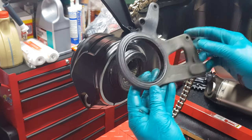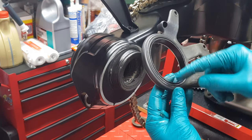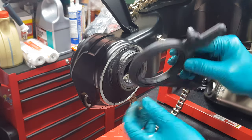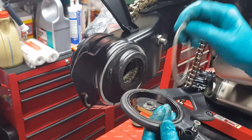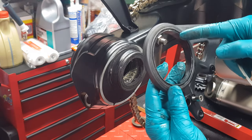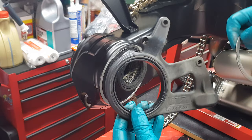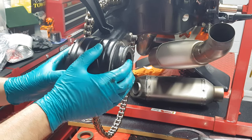Your brake caliper mount and speed sensor bracket can just slide off. Just bear in mind you've got an O-ring when you take that off — there's an O-ring here, and when you turn it over there's another washer and another O-ring. There's an O-ring on each side of this, so be careful of that. This should just be able to come out.